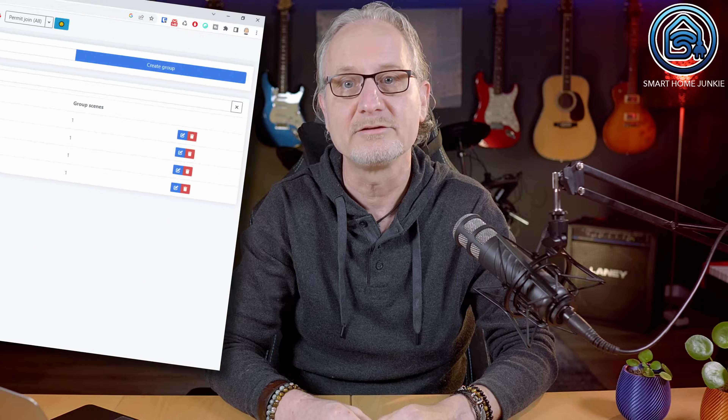The Aqara battery-powered devices turned out to be the most difficult to reconnect with the firmware that I used, but in the end I got all of them connected again. I put Zigbee2MQTT in pairing mode during that process and I had to reassign some devices to the Zigbee groups I created in Zigbee2MQTT. So it was not that big of a deal in the end. But be warned and make sure you create a backup of your Zigbee2MQTT setup before you start flashing your Sonoff Zigbee Dongle E.